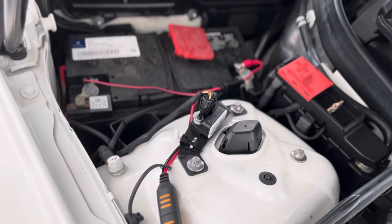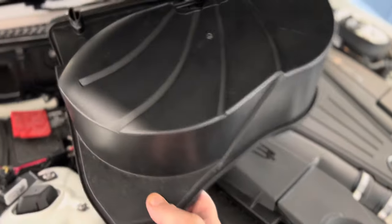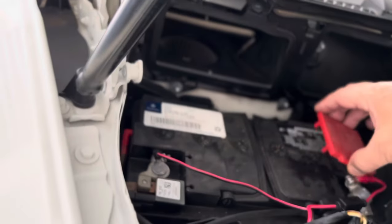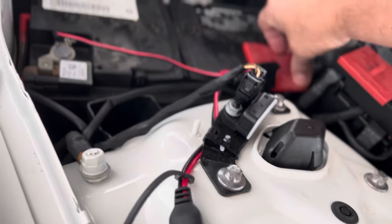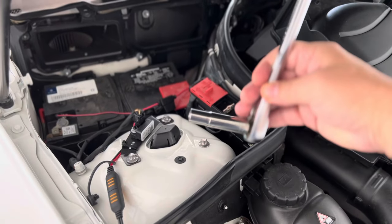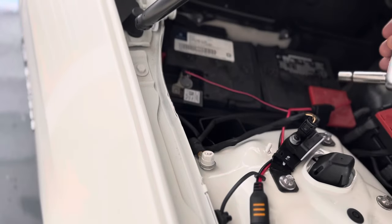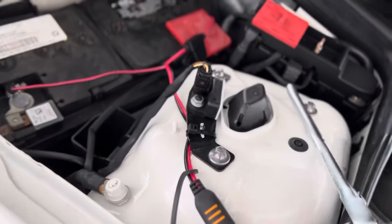So what I had to do was take this cover off. There are three clamps that come off and then you can pull this whole top off of your battery itself. This piece here fits on top of the positive cable once you're done. You unscrew those with your 10 millimeter socket — use 10 millimeter here and then the other one. Pull them off, put the eyelets on, screw it back on. And then I used a zip tie right here to secure it.